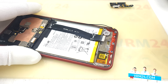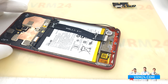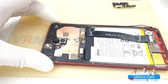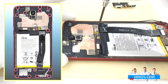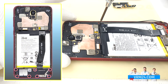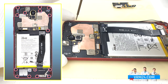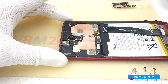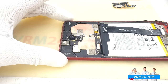By the way, here is the vibration motor. Moving on to the top — unscrew the screws with the same Phillips 1.5 mm screwdriver. It is best to put the screws in the right order, though it seems these screws are the same. Prepare a free place on the table where you can place the screws — you can even label them so as not to mix them up when reassembling.